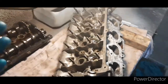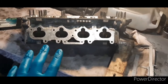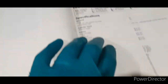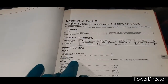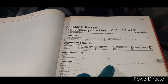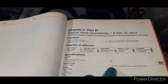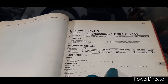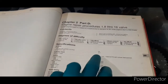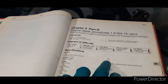So on tonight's video all the valves are back in where they should be, so we're happy with that. What we're going to do is take a couple of measurements. I want to measure the height of the head purely for reference so I know whether the head has been skimmed or not. Going back to the Haynes or Bentley manual, the minimum height is 118.1 millimeters measured through the cylinder head bolt hole. At that height, it produces a 10 to 1 compression ratio. On my 1.9 it's 10.54 to 1, so everything's been measured bang on to keep the standard compression ratio.